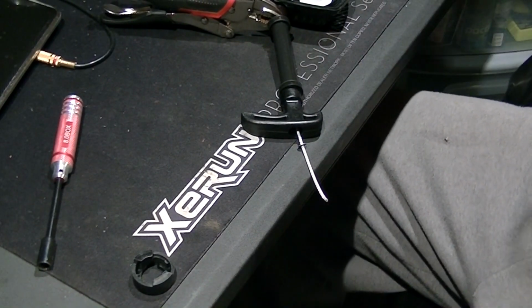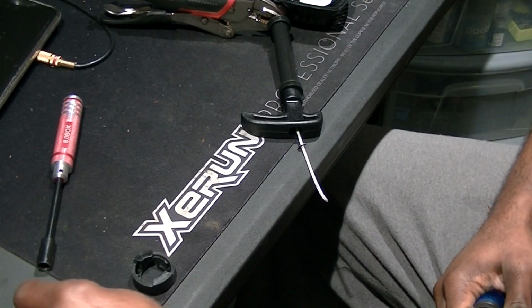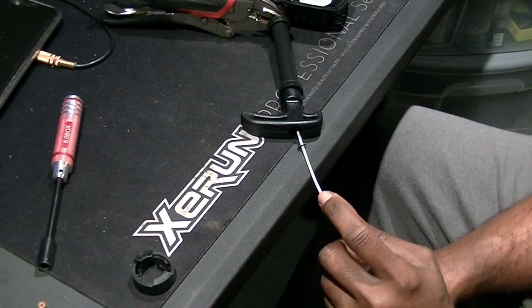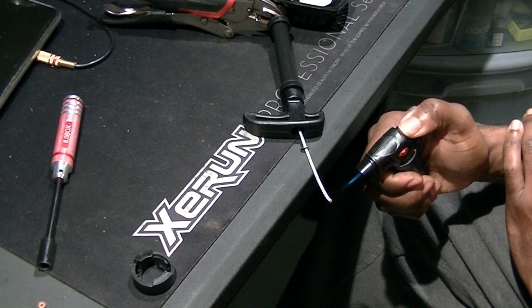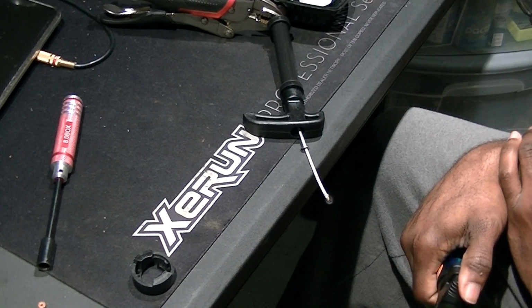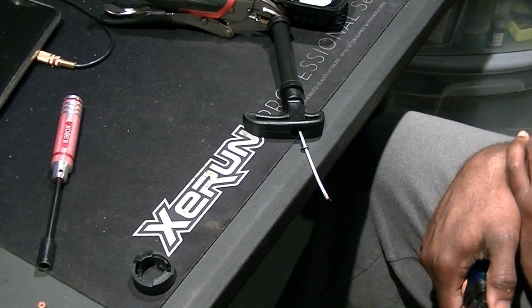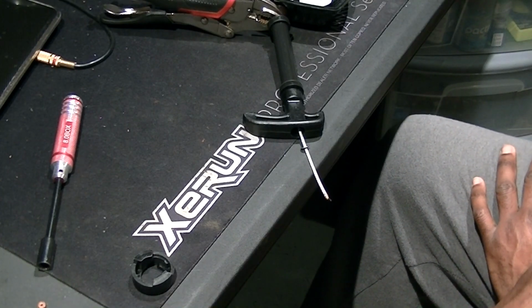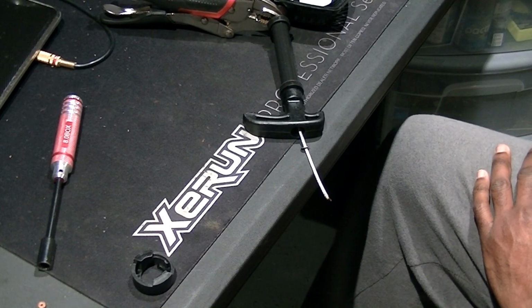this is where we get the torch out. Because when you put this crimp on, you hit it with the vise. It's got to be on a straight wire, not the tubing that's around the wire. So let's get to it. Now you just gotta let that cool off a little bit. Once it cools, then it's ready to go to the vise.